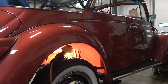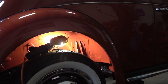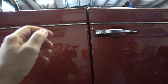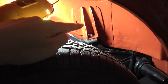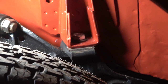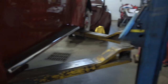We have the car up on the lift here. Since the convertible bodies do flex a bit and have some movement — even though we have all brand new support rails on this car, there is still some movement because there's no hard roof. What we had to do was address the rear shock tower area to close this gap. I'm going to zoom in — in the rear shock tower area back here, I added a bigger piece of rubber that goes in between the body and the shock tower, and I also added a steel plate on top of that thick piece of rubber.